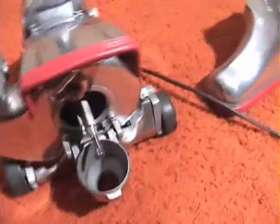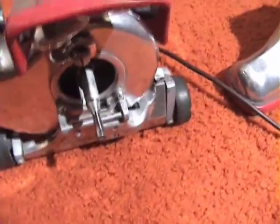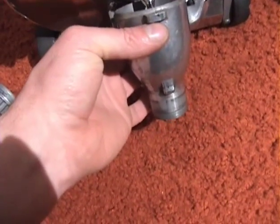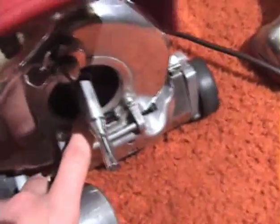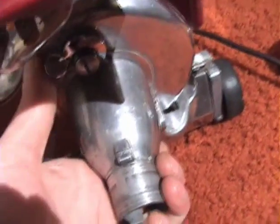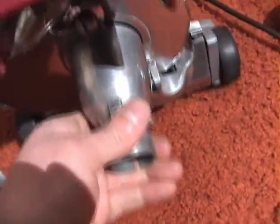Okay, now the 514 has the motor safety switch right here so that the motor will not turn on unless there's an attachment or the brush nozzle on it. So we still have to put the hose connector on the front so that the motor will turn on. Now there is no gasket on here because, as you can see, the housing is tapered and so is the hose connector. So put this on and, well, latch it in place, but it's easier with two hands, obviously.